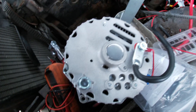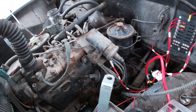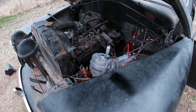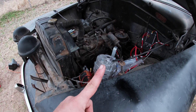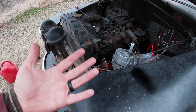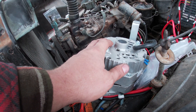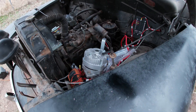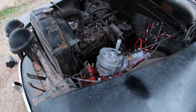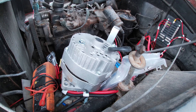That's as easy as it gets: hook your alternator up, your starter solenoid, your fuse panel, run the power wires to the key switch and you'll be good to go. All of this cost me around $240 — I say it's worth it. You're going to have easier starting, it's going to be easier to find a battery, you'll be able to add accessories, you'll have brighter lights, you can add a radio, and alternators are going to be super cheap — you could buy another $50 alternator and throw it in the trunk. If you break down, you don't have to deal with voltage regulators or sanding the points on the generator.